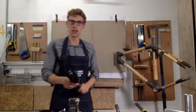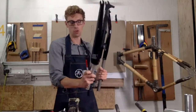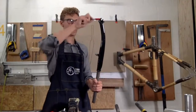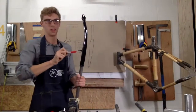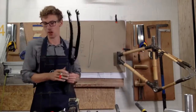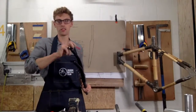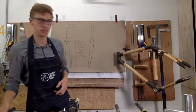If you are building a hybrid, you probably want closest to the gravel fork. So you want a larger tyre clearance, axle to crown of 380 to 370, and then you also want to make sure for a hybrid that you have mudguard and rack mounts, okay? And then obviously think about what brakes, if you want disc or if you want caliper. So just make sure that they've got those fittings.